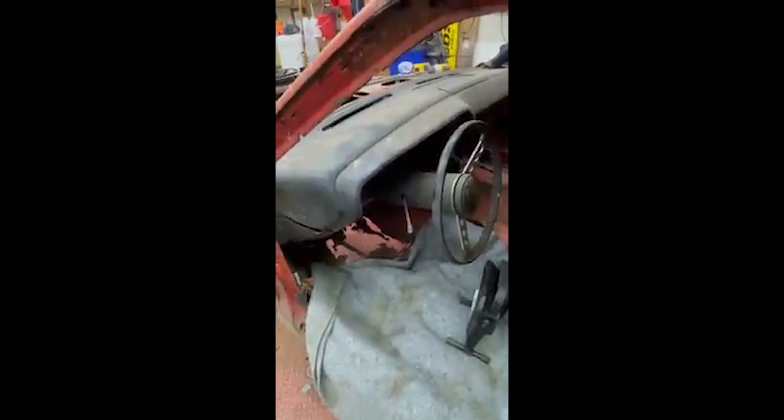I've got the dashboard unbolted; there are a few things I want to take out — the steering column — and then get that cleared out. You can see the floor on the driver's side is completely shot. There are tiny holes on the other side too, so we got whole new floors from here all the way back. Even though the rear sections look okay and look fine, underneath they're pretty scaly, so I went ahead and purchased a piece at a time and worked all the way back. The trunk is typical e-body — you get a lot of rot right across the top.